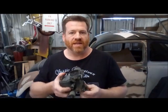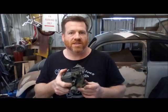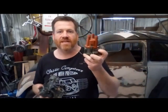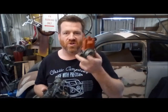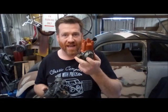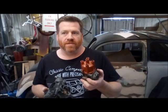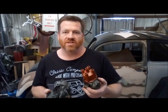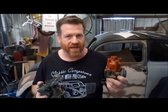We also need to cover the ignition modification. You need to grab your basic VDub dizzy and turn it into a locked distributor, which I'll show you how to do later on. That way you can preset your timing value and it's not going to alter. It's not ideal to do it that way, but if you're looking at boosting the 34 PICT you're looking at a budget build anyway.